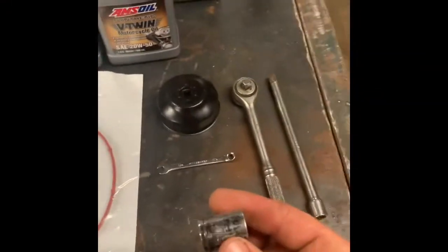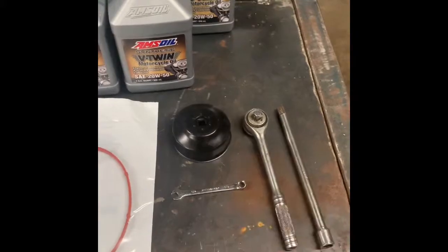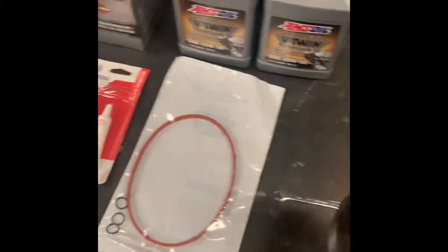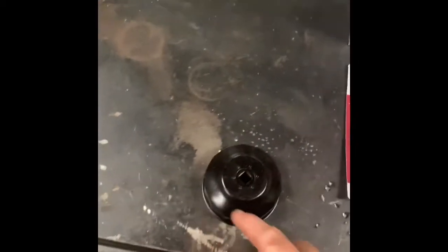With an oil change you're going to want a 5/8 socket for your primary drain plug. For your trans and motor oil filter, if you didn't want to buy the Harley tool for ten to twelve dollars, I bought one for about four bucks at an auto parts store and you gotta notch it to give you the clearance. If you can't get a regular wrench on it, it has to have the clearance on that or use the band style wrench.